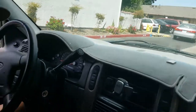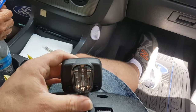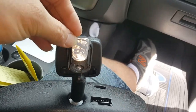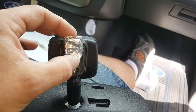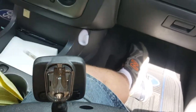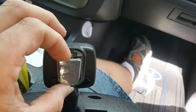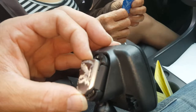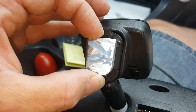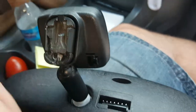So here's what's going to happen — this is the button that came out of the mirror and this is the button that comes out of it. As you can see, this comes out. There's a spring right here and a little catch right here. In order to get it out, you need to lift it up a little and then slide it because it gets caught behind this little lip right here. You need to take a screwdriver, pry it up, and then it comes out — the spring will release.